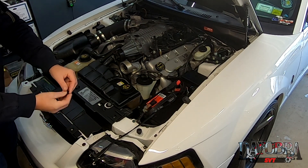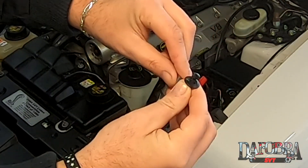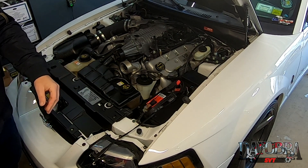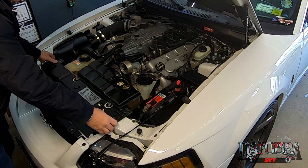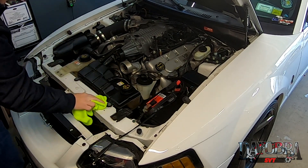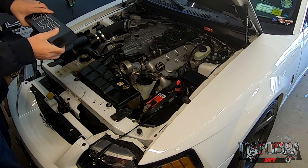Some of them can be a pain, so just to let you see what you're dealing with — this threads out, and once that's out the retainer just popped right out of the plastic. Once all four fasteners have been removed, you can simply pull off the factory radiator cover. It's also a good time to wipe everything down because you'll probably never see this again.